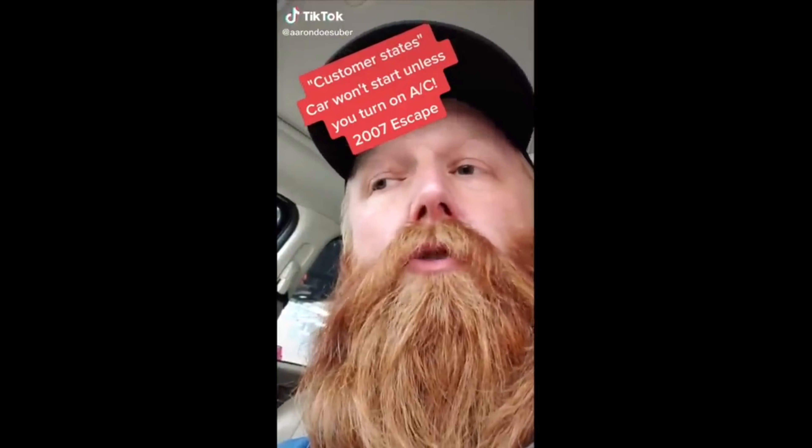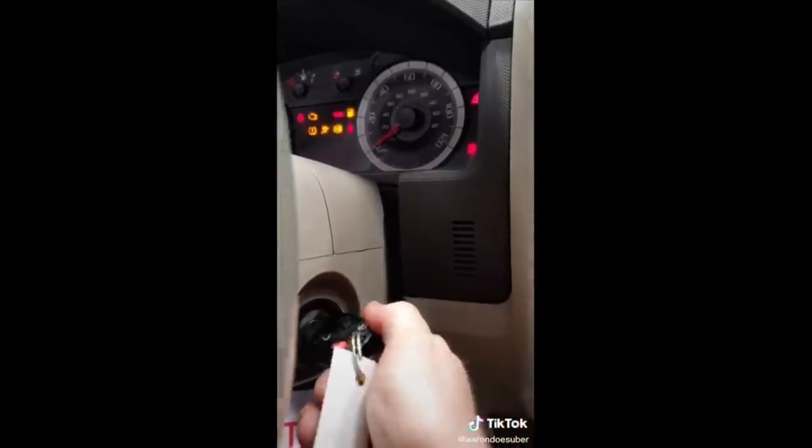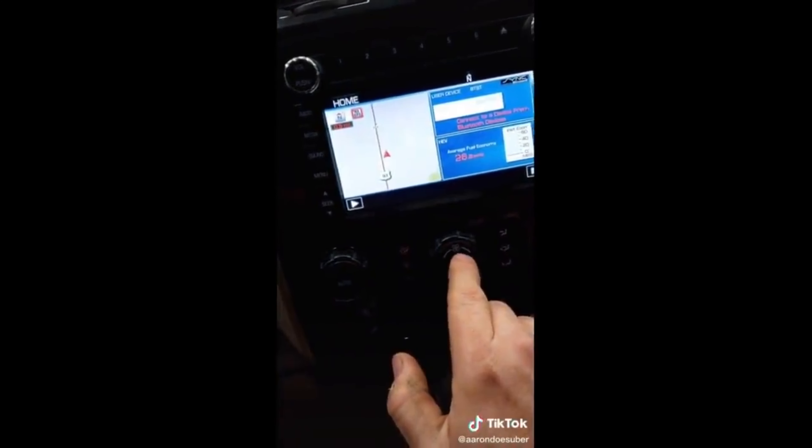Customer just purchased a used vehicle and it will not start unless you turn the air conditioner on. Most hybrid cars will not put the engine on when there's no load needed from the engine. Now he's putting the AC on — the AC is driven by a belt attached to the engine, so the engine needs to run. Your used car you just bought? It might be a hybrid. We're going to rule that out as normal operation.